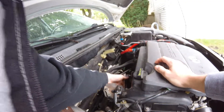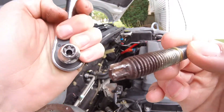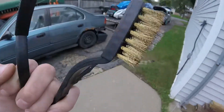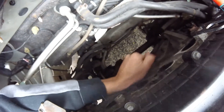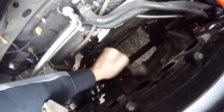See, that's the end to it there, and that's what I use to take it out. Brushes on brushes on brushes - cleaning everything up. Alright, so I'm gonna go ahead and put all of the studs back in the engine and then place the gasket on there. Right as I get the manifold back on the car, I'm gonna go ahead and grab you guys, so I'll see you once I get to that point.